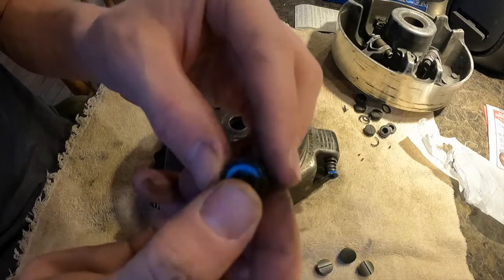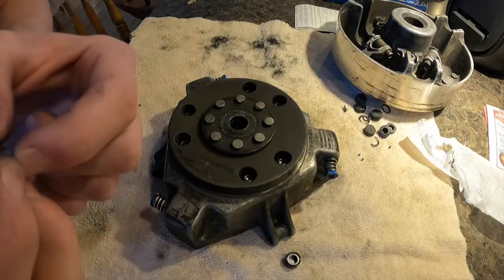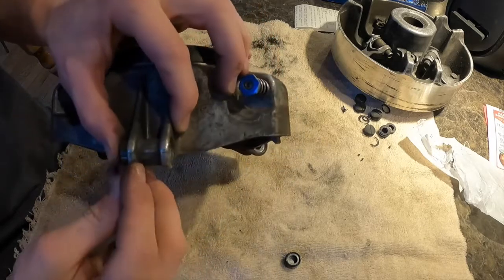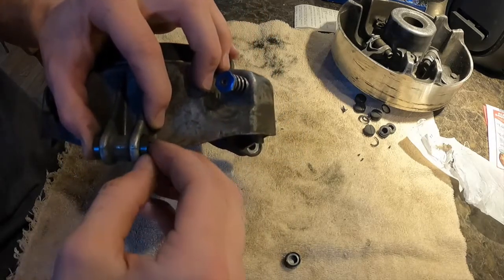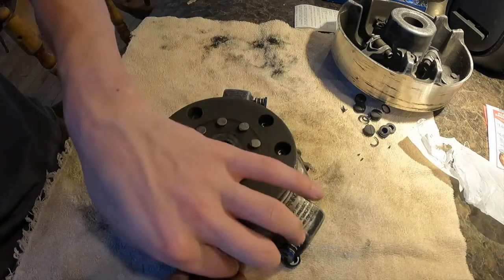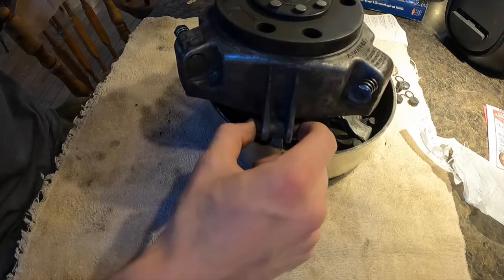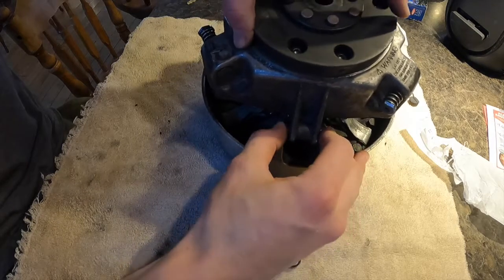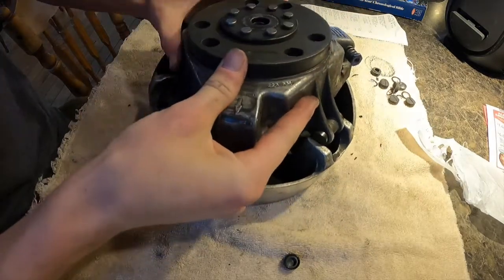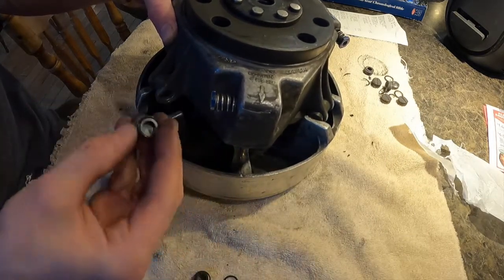After you've cleaned out those little areas, it's time to put your buttons and o-rings in. The easiest way is to put the o-rings over the buttons first. The o-rings and buttons just sit in there like this. There is a tool set you can buy to hold them in while you slide in the other part of the clutch, but you don't have to use the tool. I just did one or two at a time, holding the two buttons on each side, sliding it in halfway, then turning the clutch and repeating all the way around.